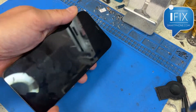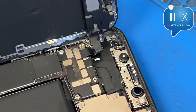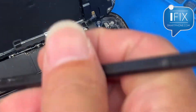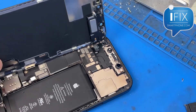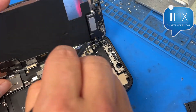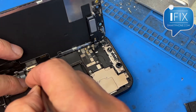Because if the display was bad, you wouldn't see the Apple logo. Right now the phone is actually on — you can feel the click — but you just don't see anything, kind of really super dark. I'll show you what the cause is. Everything is connected: the proximity sensor, display, battery. I just have to unplug the battery first to power it off. The phone is powered off now. If the ambient sensor or proximity sensor is disconnected I'll actually show you — this is the display and digitizer connector connected.